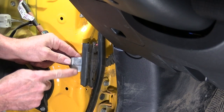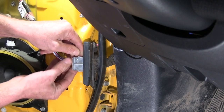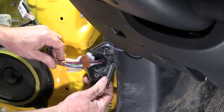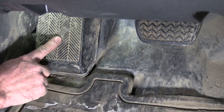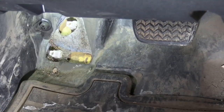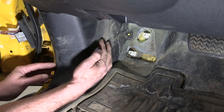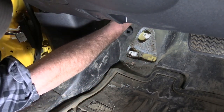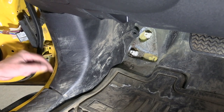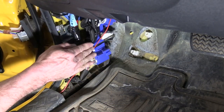You're going to find a piece of tape right here holding this on — just cut that. There are two tiny clips holding this white plastic plug — release them and it comes apart. What's called a dead pedal right here has to come off, and these come off really easy. Then there's a little fastener right here — unscrew that. This kick panel here comes off really easy, it just snaps in place. Pull it off at the back, pull it out a little bit from underneath the threshold panel.